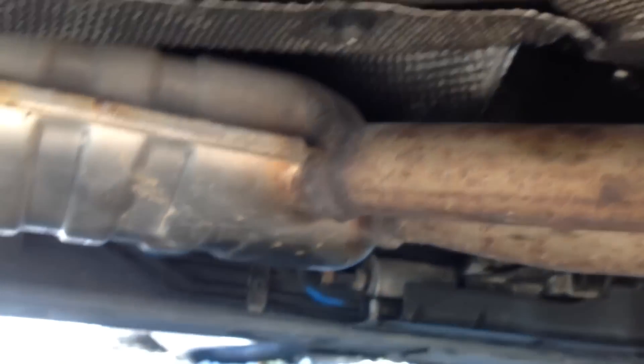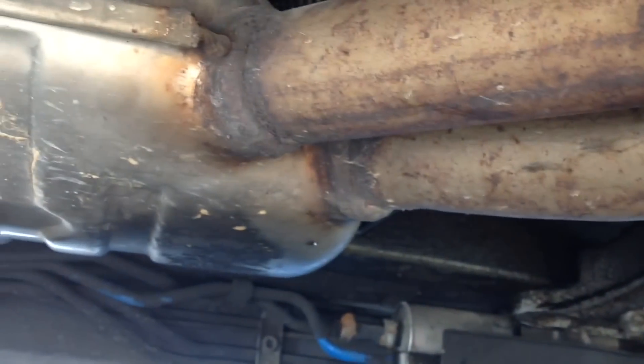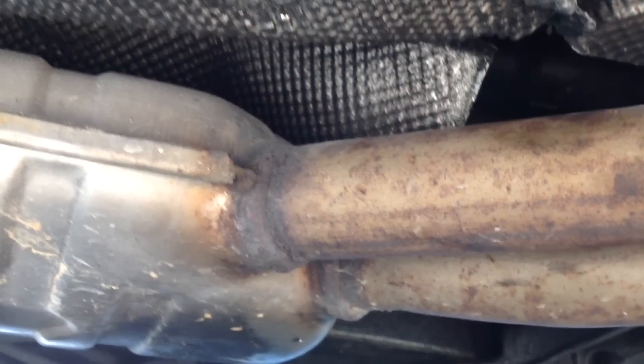Right there. It's not tin, it's actually aluminum. You take that down — the cross members actually bolt to that and hold it up. There are two tens in the front, one right there, one on the side you can't see from here. Right above the converter, if you have a battery impact, this is a pretty easy job. The hardest part is getting the guibo out. I always take the three bolts out first on the guibo that take the shaft loose. So you take those three out, and you take the carrier bearing out, which is under the converter over here — there's two bolts.